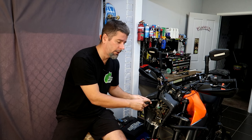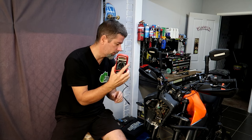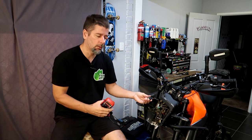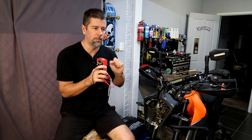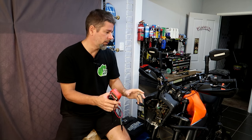One of the wires to the headlight does actually have a 12-volt positive power source when the high beam switch is on, so it should be super straightforward. The guy in the reference video mentioned a blue wire into the headlight plug for the high beam, but this one doesn't have a blue one. With my trusty multimeter I've figured out it's the red and black wire that's the high beam one you want to tap into. I want to do exactly the same thing as I did with my bike — have the auxiliary lights on the high beam switch.